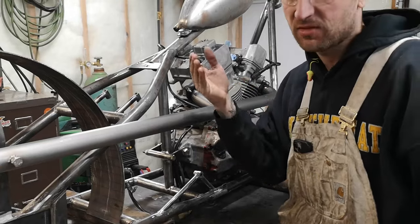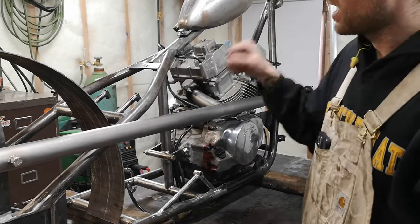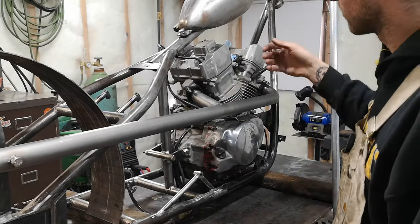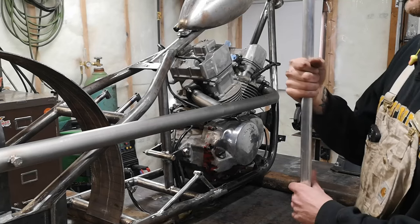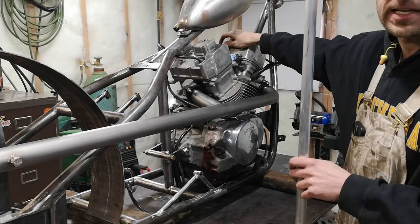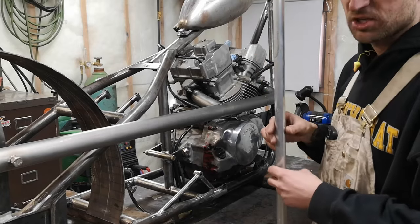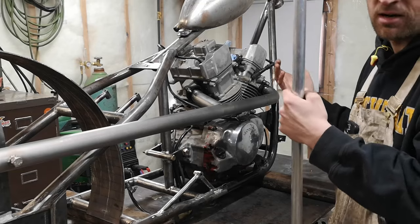I thought about just cutting the fittings off — like the bottom of the radiator and off the little thermostat housing — but if this doesn't work, I'm going to have to go back to a radiator. My friend Phil graciously donated this one-inch stick of 6063 to me, and I'll copy these hose clamp fittings. I'm not going to run a thermostat or anything — it's a Honda Shadow. I figure if this thing's got juice running through the water pump, it's going to run all right.